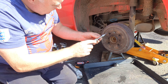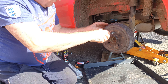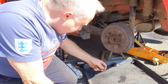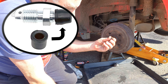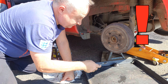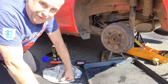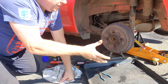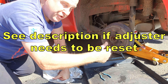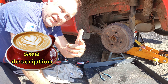Return your drum to position, not forgetting to line up the hole for the securing screw, and put the securing screw back in — just a light hand tight from your old cylinder. Rescue the little cap that came off the bleed nipple; you'll probably need that for the new one. Make sure to remove your brake hose clamp, and then don't forget before you put the wheel back on to bleed this brake — a few pumps should be all it takes. Also make sure that it's free to move and that you haven't accidentally wound up the adjuster. If you've got value from this video, consider supporting the channel in some way, and I shall see you next time.